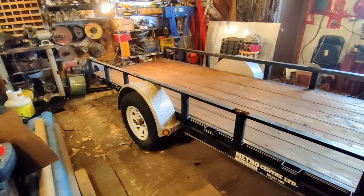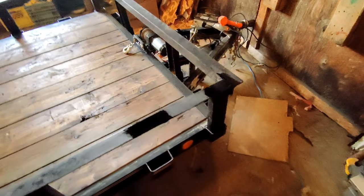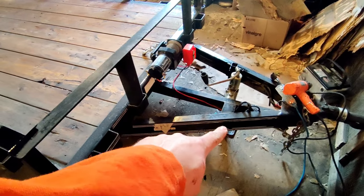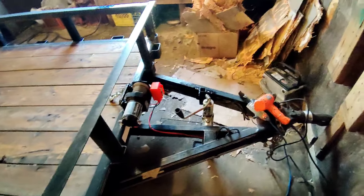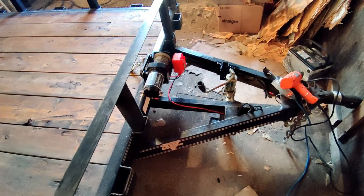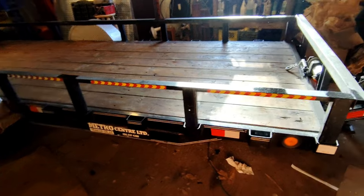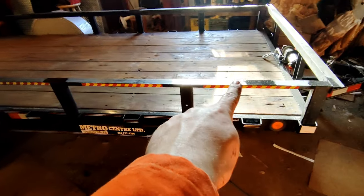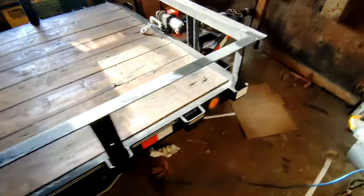Okay guys, got the sides put back on and I touched up some spots where I took the canopy off - smoothed it out and painted it. She's looking done and good. I'm going to be putting some DOT reflectors on some different places. The best tip I found in the winter - take a heat gun, warm up the area where you want to stick it, make sure it's nice and clean, then stick them on and they won't peel off in a couple months. Got the DOT stickers everywhere, and some reflective tape around the sides, with a couple big pieces on the front that wrap all the way around.